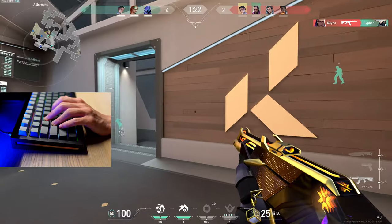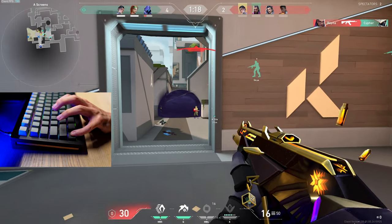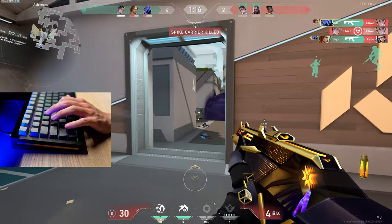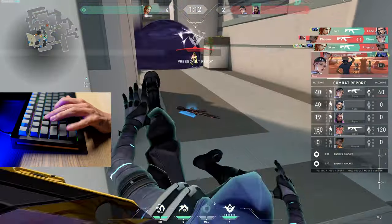performance. But that aside, using the keyboard with a wired connection is great, but under the condition that I don't use it on the absolute lowest trigger points with rapid trigger. Setting rapid trigger to 0.1 millimeters on both the upstroke and downstroke kept cutting off my directional movement, but I found that setting it to 0.2 millimeters on the upstroke was a much better experience. Now, this is something I experienced with another similar keyboard, and that had a slightly different PCBA, so I got a feeling that this might be because of the switches.